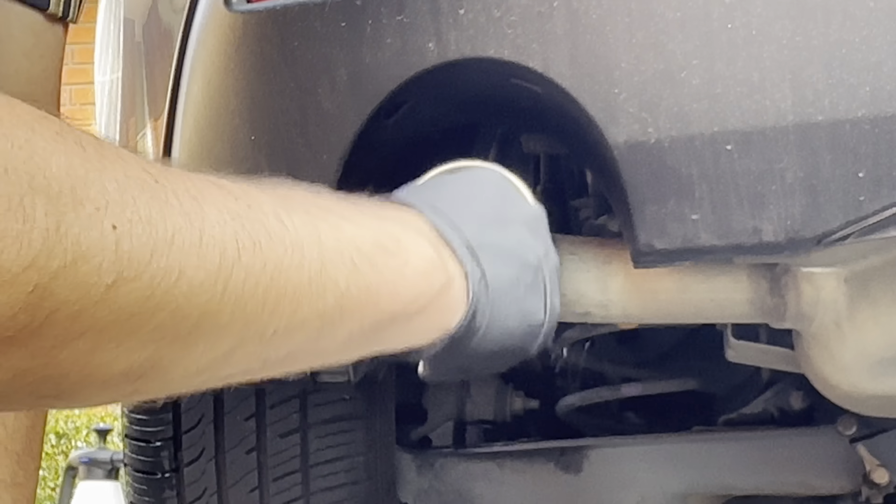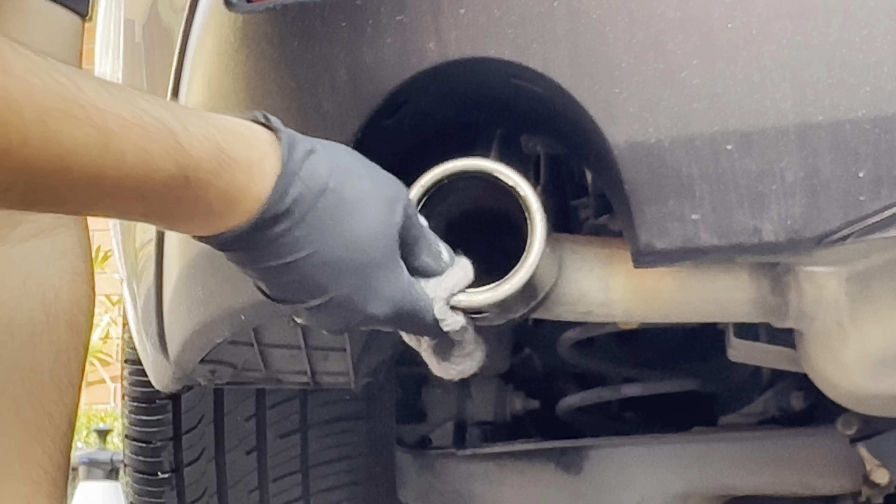After this I'm going to use a metal polish — I'm using Chemical Guys Heavy Metal Polish, which is the most coarse metal polish I've got at the moment. Just pop it on the steel wool and spread it around. You're agitating a little bit with the steel wool but not as much as with the acid cleaner — just spreading and rubbing it in. I'm getting it inside the exhaust pipe, around the face, and around the barrel of the exhaust pipe as well, trying not to hit the body at all.